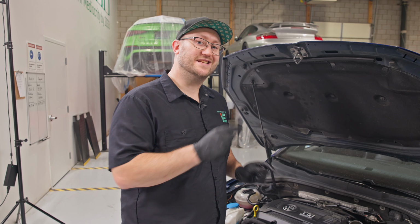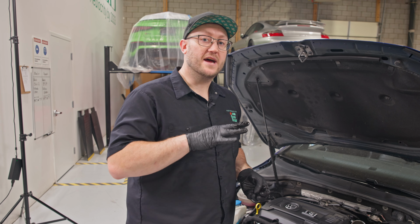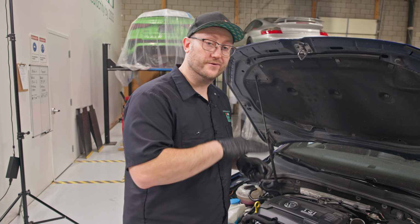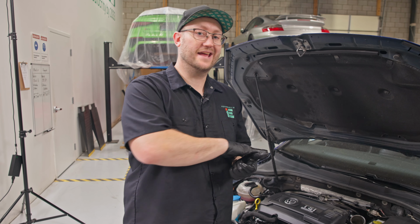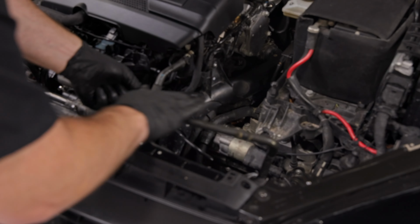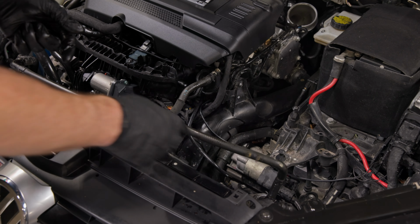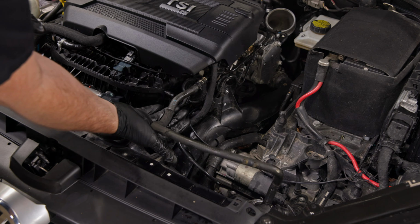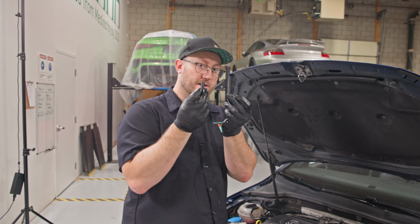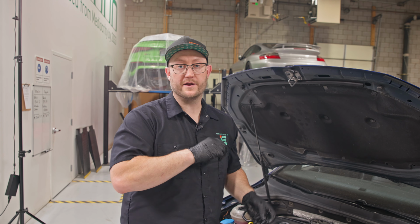In this next step, we need to remove the factory coolant line. Make sure the car has had plenty of time to sit here and cool down so you don't burn yourself with any hot coolant. You want that coolant to be completely settled and cool as possible. Since the factory coolant line runs over the top of the intake, that is going to be in the way of your much larger aftermarket one, so our new supplied one is going to sit low and under it. We've included 2 coolant port cap-offs. These are just here to keep coolant from spilling out while you work around it.